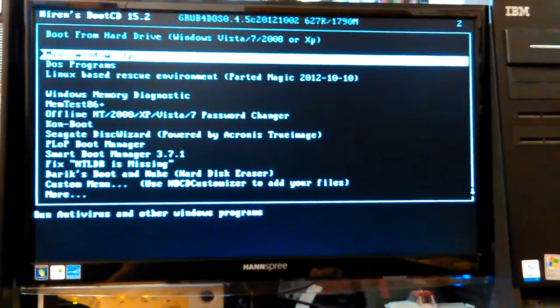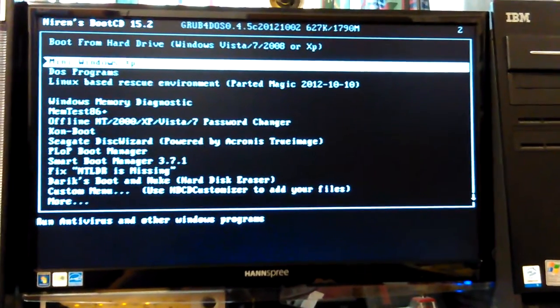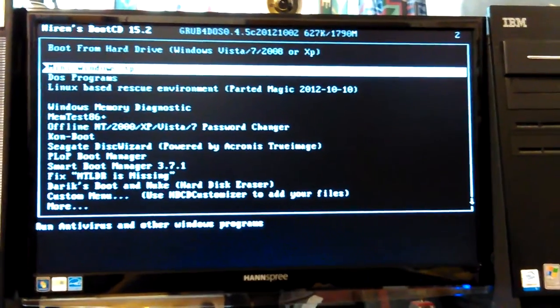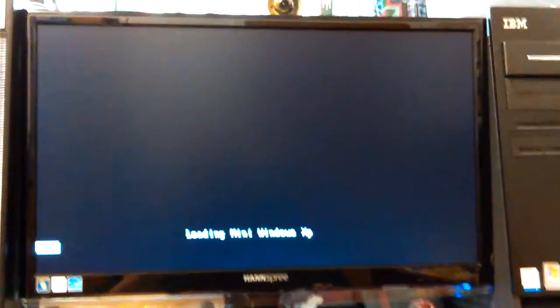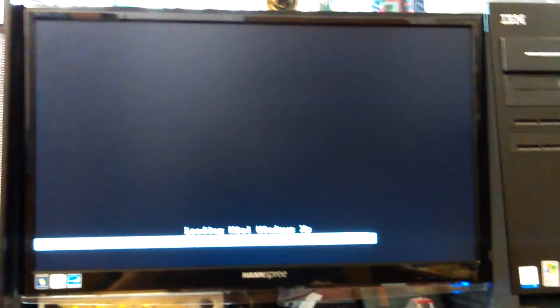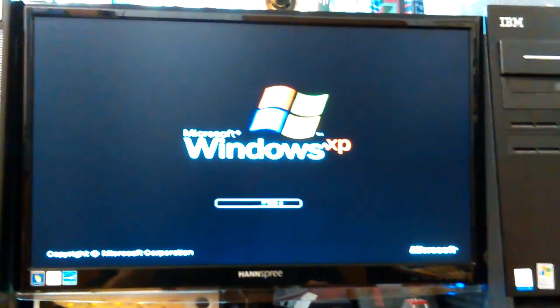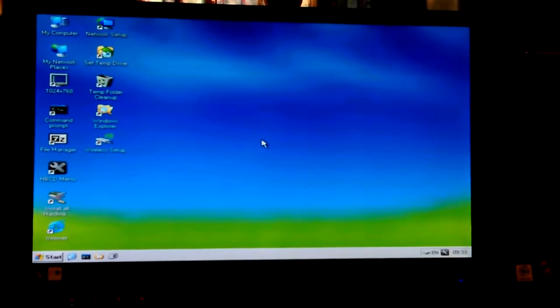I didn't get the full menu. I was watching back one of my older videos - it was when I tried to put it on this SD card, but it wasn't with Easy2Boot, it was with trying to use UNetbootin, and it wouldn't even show all the menus. See how fast that's going across there on the SD card as opposed to the USB hard drive - that's an IDE, not SATA. A good example of how much faster an SD card can be read than an IDE hard drive on a USB adapter, and they're both on USB 2.0.